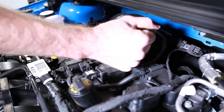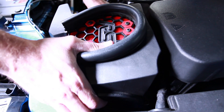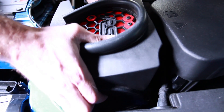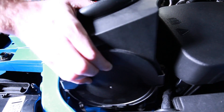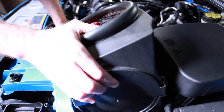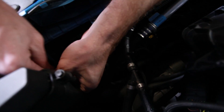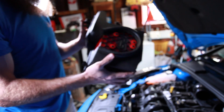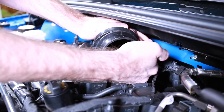Just for peace of mind I'm going to take the air filter box assembly out. Basically all you have to do is pull up — these are just in rubber grommets at the bottom. The top one you just slide out of the rubber grommet, it slides forward a little bit and pops right off. We can set that aside because we're not going to be using it anymore.